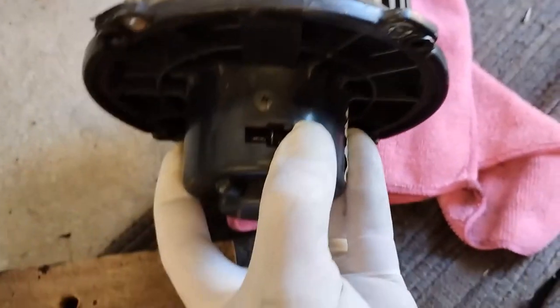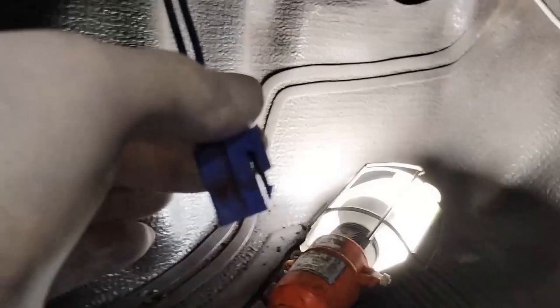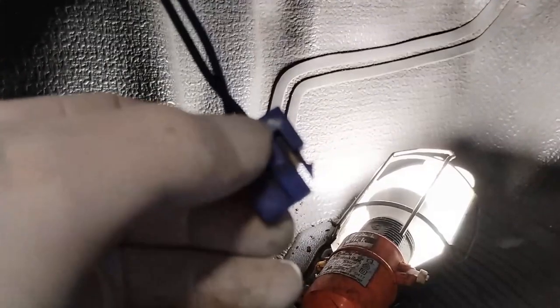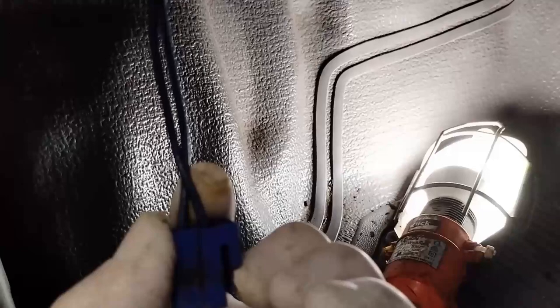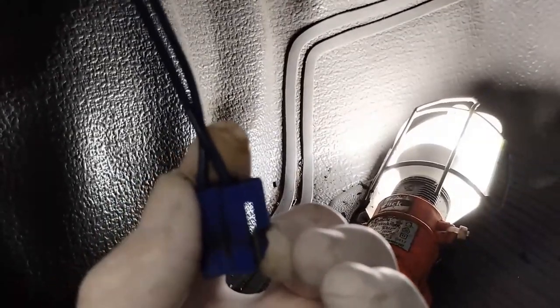There's one screw for the other side and there are four screws to hold the fan - one, two, three, four. That's the fan electrical connection and you can see the electrical connection there. So this notched-out V, and on the other side you can see the fan connection. The other side of the fan connection underneath is exposed there - push down underneath and that will release.